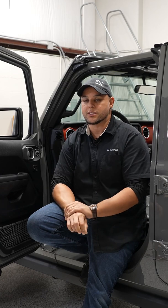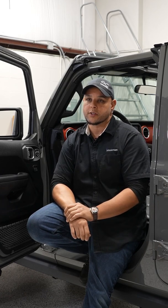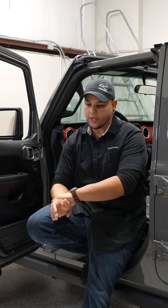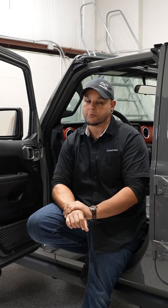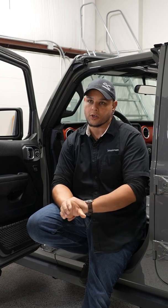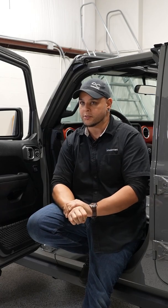If you think the sound is missing a little bit of bass, maybe you can start with the trunk or the rear of the vehicle forward as opposed to starting at the head unit and working your way back. Usually adding a little bit of bass to your factory system will please most people, filling in that gap or loss of sound that you think that you're going to get from an aftermarket system.